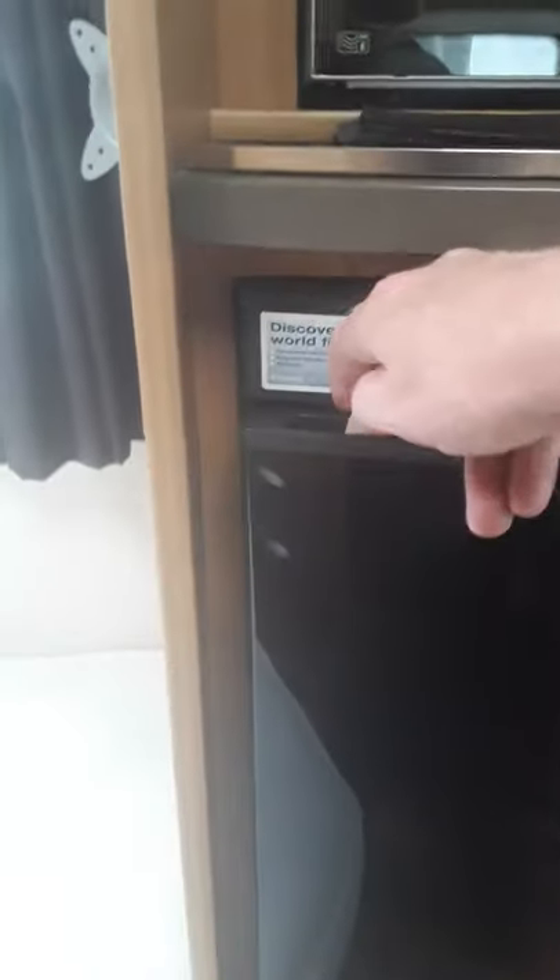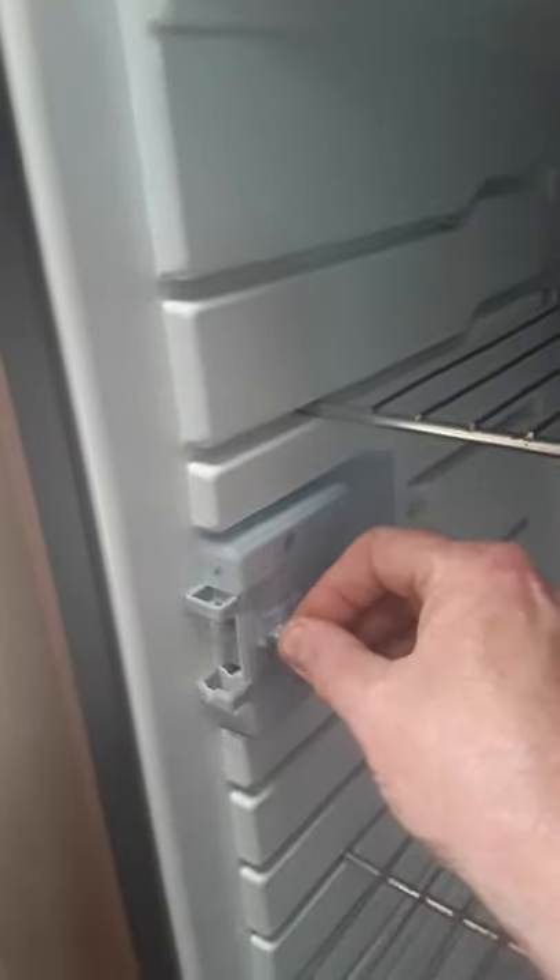There's not much else to your fridge. I'll just show you the door — you just press the little button here and the door opens. Inside the fridge, there's a wee catch here that pushes in and out, just on the light here. As you close the door, that'll vent the door for you when you're not using the fridge. After you come home and switch the fridge off, you can bring that out there and when you close the door it just leaves a wee gap, letting air into the fridge. Then just push that back in again — that's the normal position it should be in.